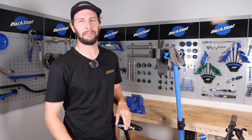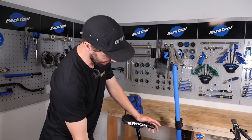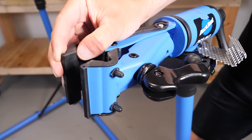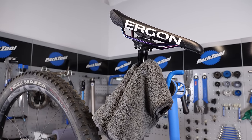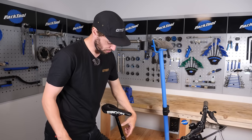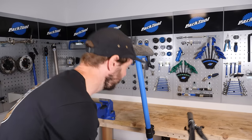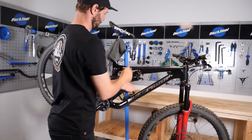Let's talk clamping your bike — where and how to do it. There are definitely some do's and don'ts here. If you've got a dropper, extend it and you can clamp it on the extended part of the dropper post. Most stands will have these rubber jaws to avoid scratching and marking anything. If you want to be really safe, you could chuck a rag in there as well. If you don't have a dropper post, don't worry, but you do need enough solid seat post extended. Try not to clamp around the actual seat clamp or anything like that — it should hopefully go in smoothly, hold the bike, and you do that one up nice and tight.